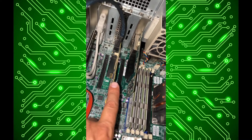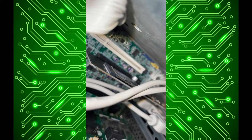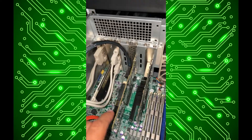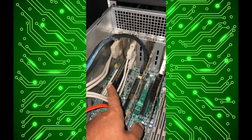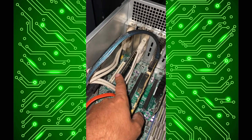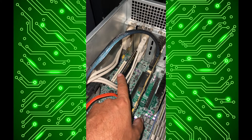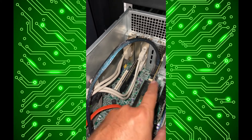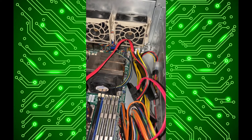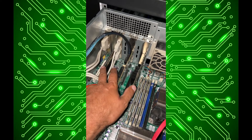The other cool thing — you're not going to be able to see it very well — but they make these add-in cards, and you can kind of see it there: it has an NVMe drive on it that's 2 terabytes. The adapter card that goes in the PCIe slot was only five bucks. I'll have to run some tests on it and see how the throughput is, but basically now this old server motherboard can have an NVMe drive, which is going to be hundreds of times faster than the SSDs I'm using through the SATA ports, which are only 6 gigabits a second.